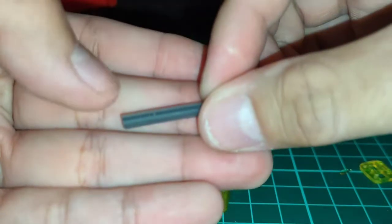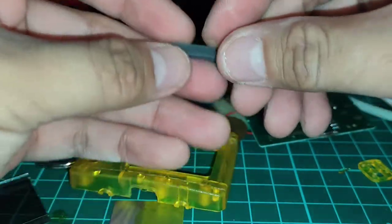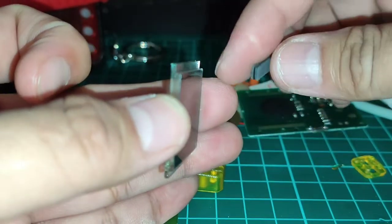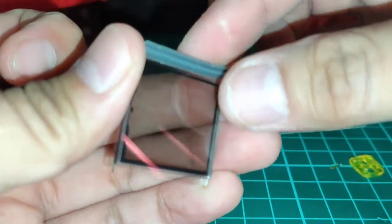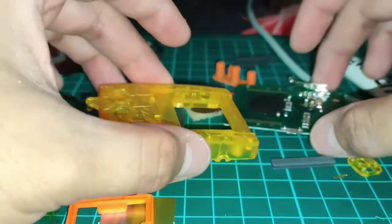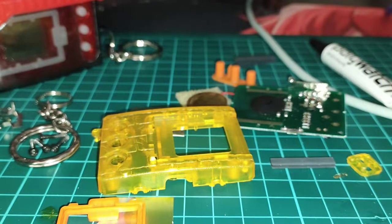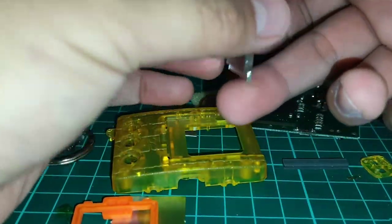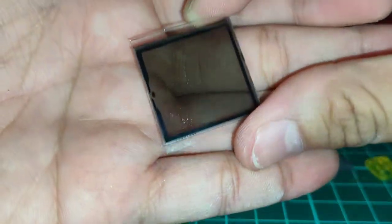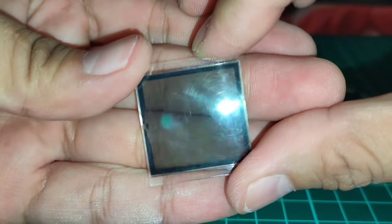I would also recommend cleaning these rubber contacts. By using pressure, this is what causes the image to pop up from the board to the screen. They kind of just hang up here at the top — as you can tell the LCD has a lip where these things tend to sit. You can just take it right off and clean the contacts as you see fit. After some polishing, all the micro scratches are still there, but it is a lot better than what it was before, which is kind of what we're going for.